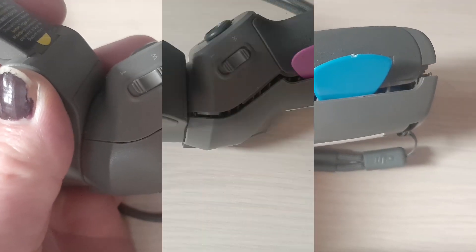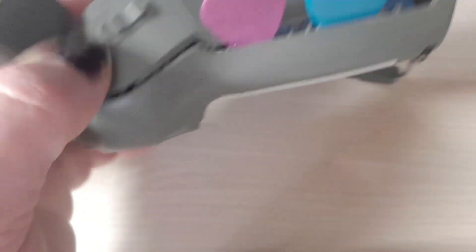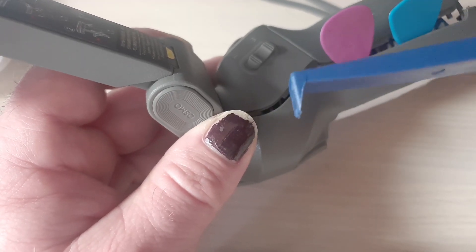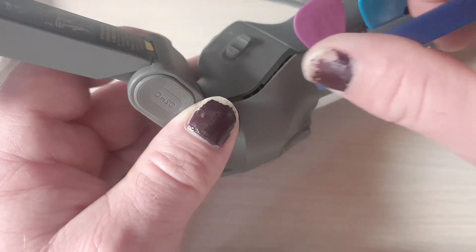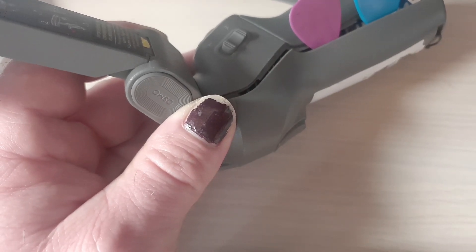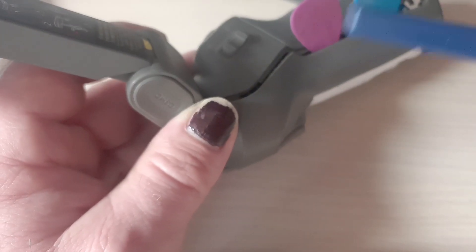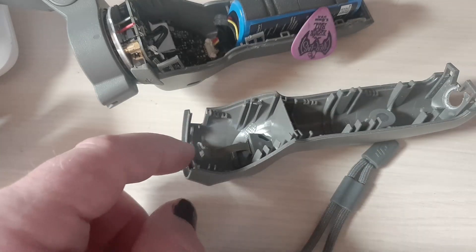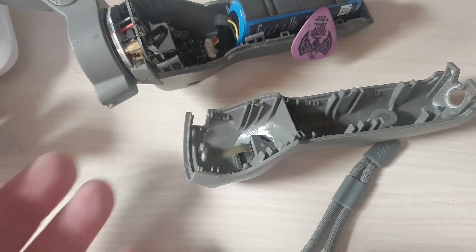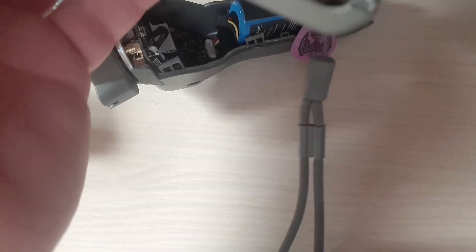A little bit of wiggling — and it really just was wiggling to start with — and a couple more cracks. I managed to get another guitar pick in the other side and I've managed to open this seam here. You can see I've got this angled nylon pick. It's really good because you can put quite a lot of pressure down on that piece with your thumb and compress the plastic a little to release those lugs. I thoroughly recommend one of these angled ones — you can buy a kit. And now, very much the same problem as taking the first one apart: there's just literally no space to get this trigger cable out. It comes too fast and I'm not envying putting that back in.